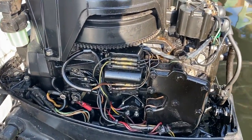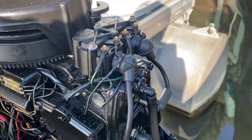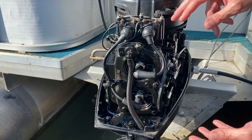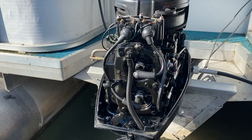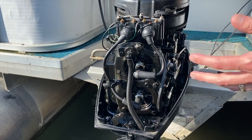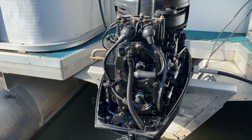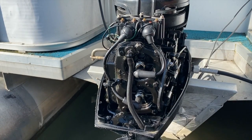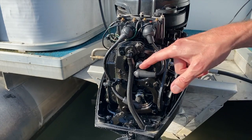Taking a step back — that is one of the common causes, but I will be honest, that is the least likely of the three I'm going to talk about. The most likely is your actual spark plugs. We're looking at the back portion of the outboard where the cylinders are, the spark plugs, the boots, the wires, and the ignition coils. The most likely common cause on an outboard misfiring at high RPM is the actual spark plugs. When you remove your cap, direct your attention to the plugs themselves or the inserts of the cylinders and check to see if anything's out of the ordinary or damaged. I recommend taking off the spark plug boots and removing each plug from the cylinder inserts with a ratchet and socket to check the electrode end of the actual plug.